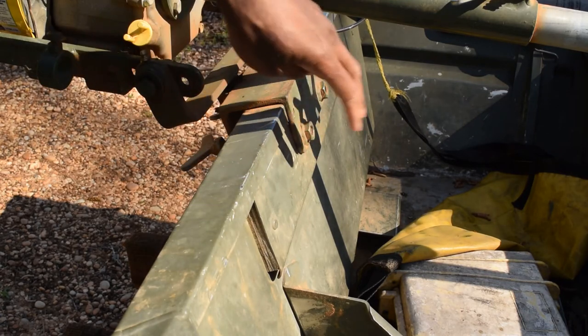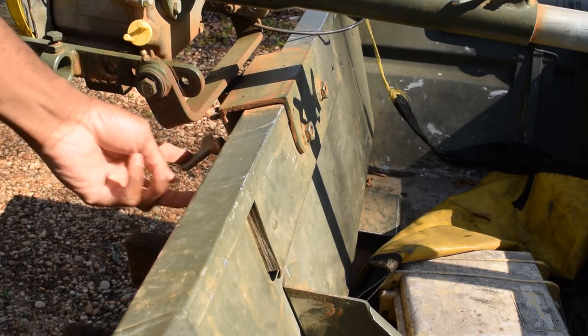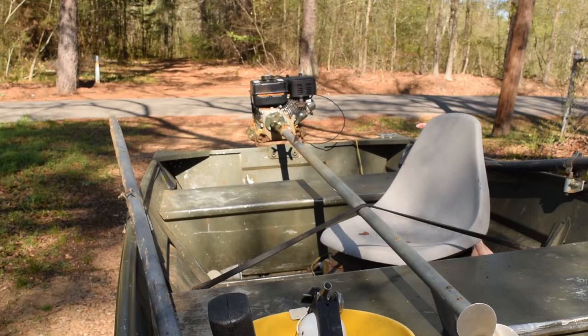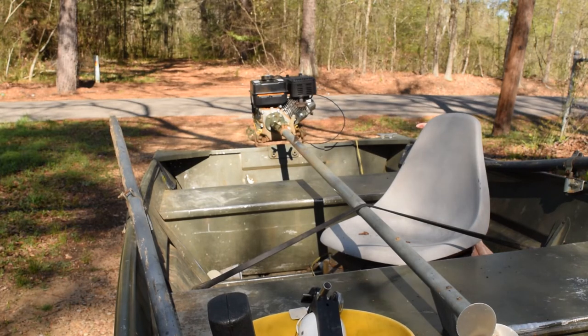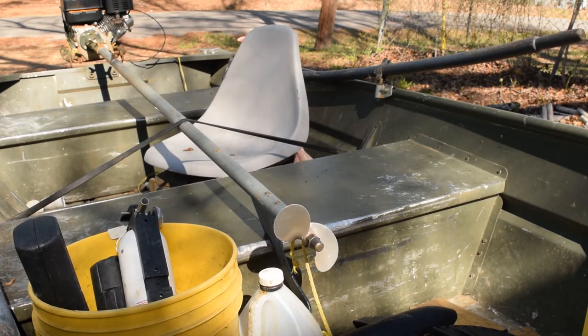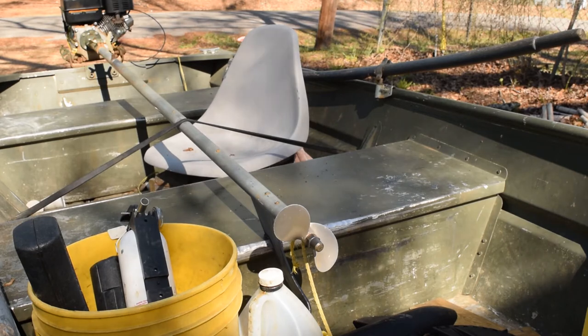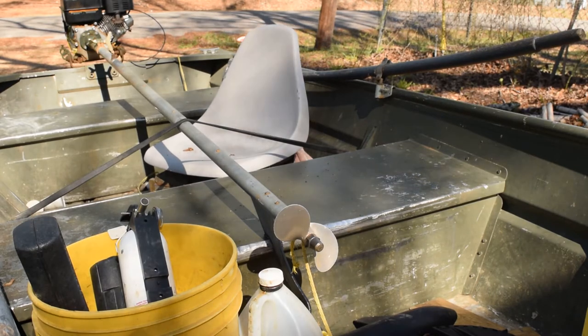My motor's bolts are designed to go in the back there. You can either put them here or here. This motor is a Thailand long-tail outboard motor, designed to be long because the propeller is designed to run in the wake of the boat, in the crest of the wake. If you shorten it up, you'll be plowing the bow of the boat into the water. You see how incredibly parallel that shaft is with the boat right now? That's exactly what you want — the long shaft keeps the motor as close to parallel as possible.